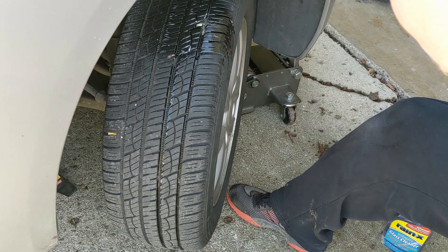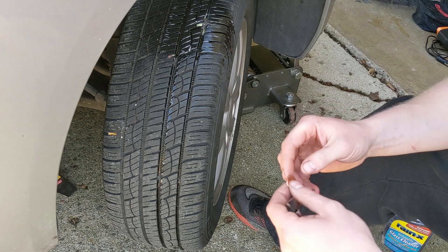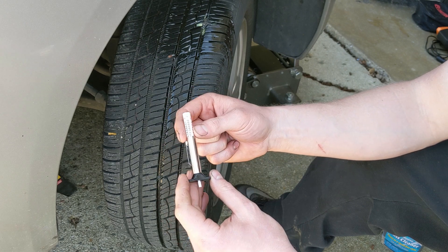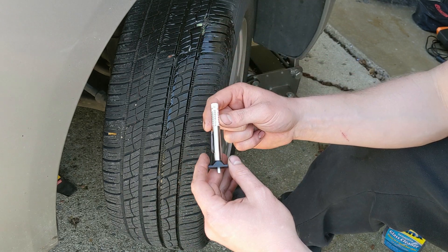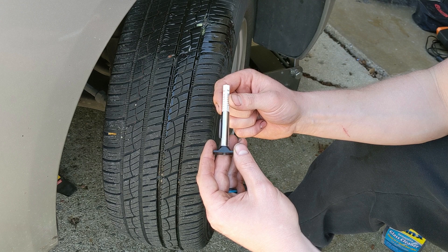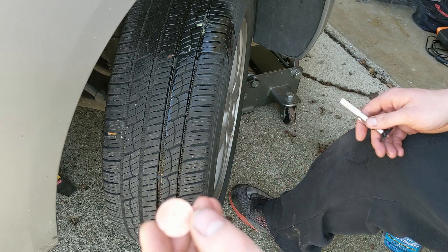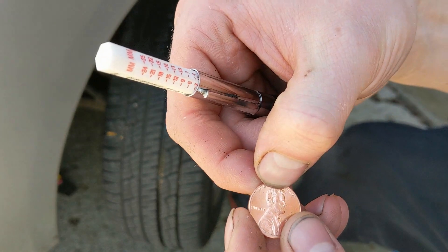That's it — very simple, about a ten dollar fix. Great to keep in your car on the side of the road. Now while you're at it, check your lug nut torque. You can also get one of these tread depth checkers or gauges — I have this linked down in the description. Your tread depth should be no less than 2/32nds, and that's actually very, very low — not very much tread whatsoever.